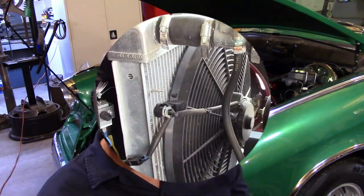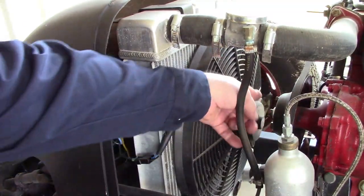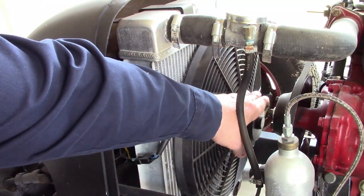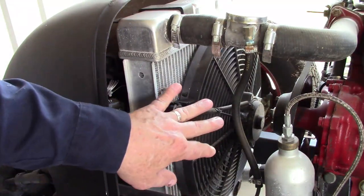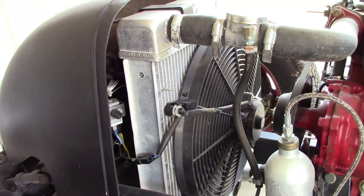You can put an electric fan on the front side or back side of the radiator — it's very accommodating. Here's a good example: my water pump shaft is right here, which would throw the fan blades way off to one side. But with my radiator centered in the frame, I was able to position this electric fan in the center of the radiator and it worked out really well. One of the negatives on electric fans compared to the so-called parasitic draw of a mechanical fan is that with an electric fan you may need to upgrade your alternator because you're drawing a lot more amps.